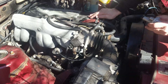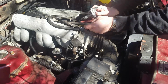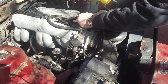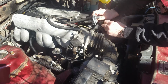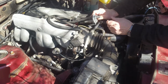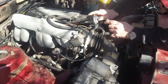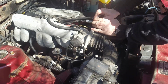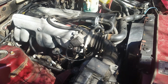Okay, this now has a nice big air gap and a closing time of 320 seconds as opposed to almost no air gap, and it wouldn't start a car, and 70 seconds of closing time. So this should be an improvement. The car has not been running in 2 weeks, so it's also just a very nice way to do a cold start for testing that air valve.